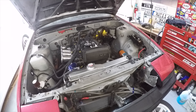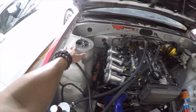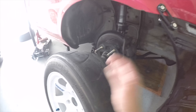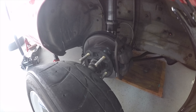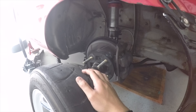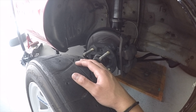Next, after you check your fluids, make sure there are no loose bolts. I had issues with my suspension — after a track day I noticed my wheel felt very loose, my steering wheel was vibrating a lot, and the car was even wandering left and right. When I got home I jacked it up and found that the suspension was loose. It was these two bolts underneath here, and I found out I needed to put Loctite on them. It's a rookie mistake, but you learn as you go.